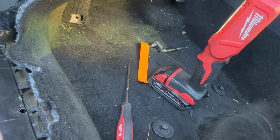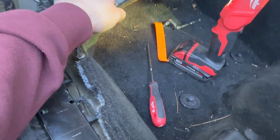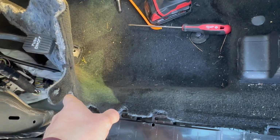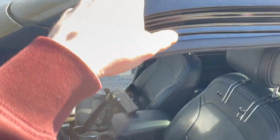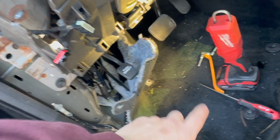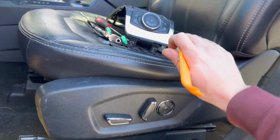What you want to do also, take all your tools out and push the carpet all the way up, so this way you can also run some tests and pour some water again through the drainer with the cup and see where is the water landing, and then follow the water and you'll find your drainer. I'll definitely like to use more space here, so that's why I was telling you eventually we have to take the seat off.